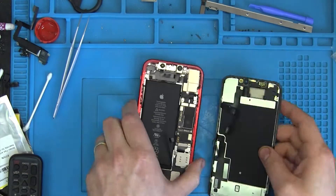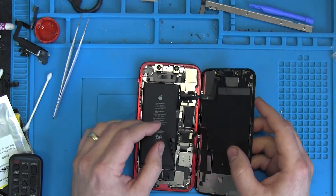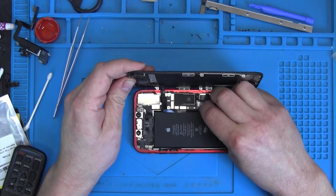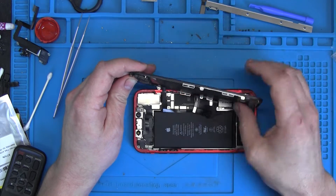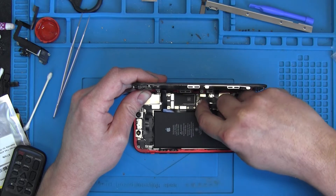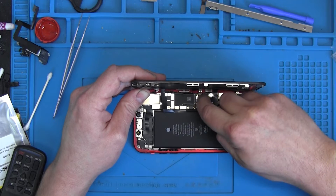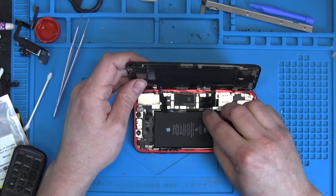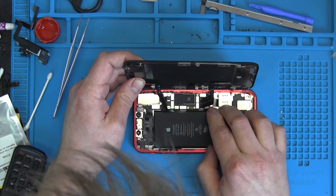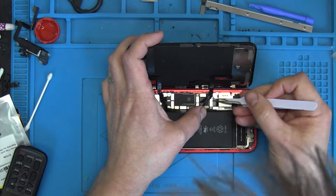It was okayed by the owner of the phone that Face ID will no longer be in use. Then we attach the connectors again — remember battery connector last, always last — otherwise you run the risk of breaking your device. Don't use too much force putting the connectors in; once they are aligned correctly, use a small crunch to confirm they're connected. They do not need lots of force, so take your time to align them correctly and you'll be okay.